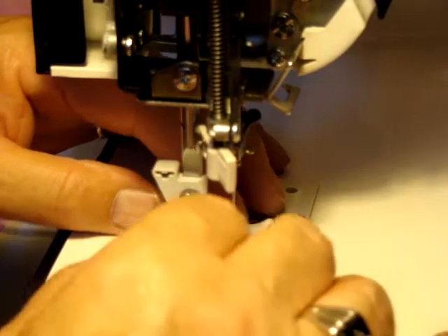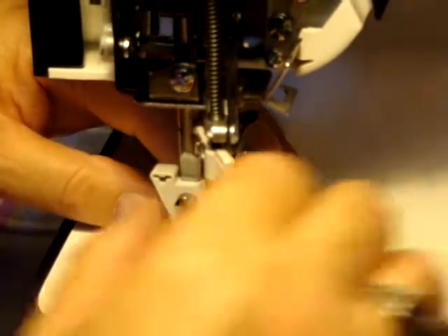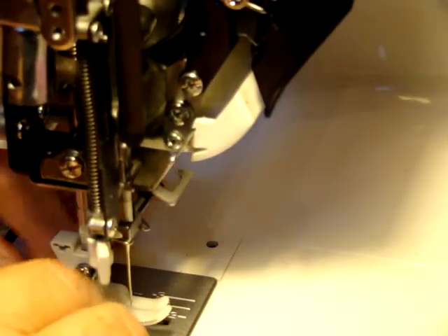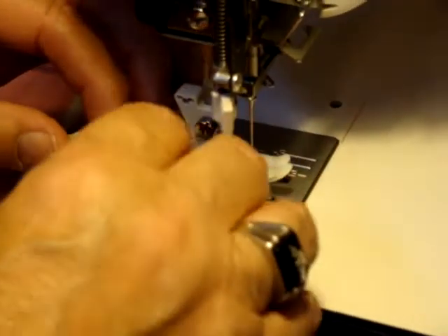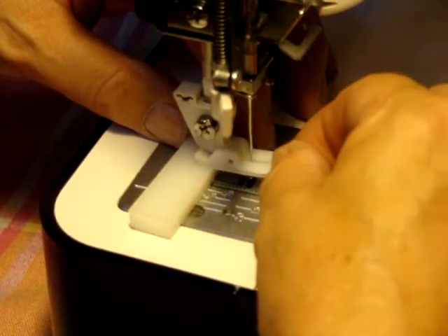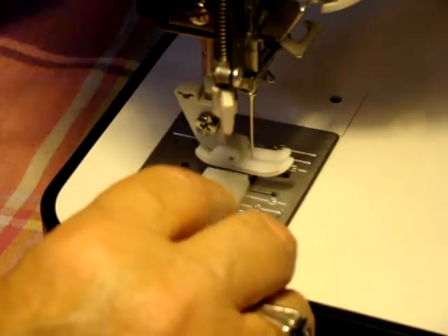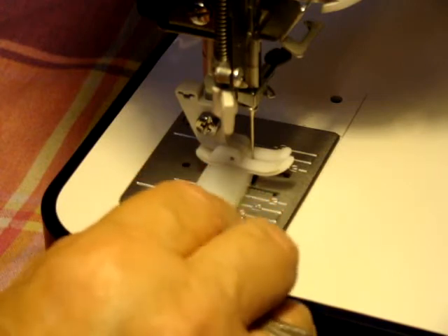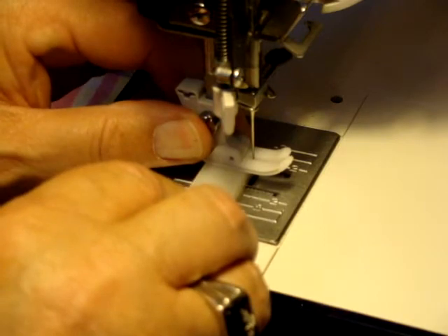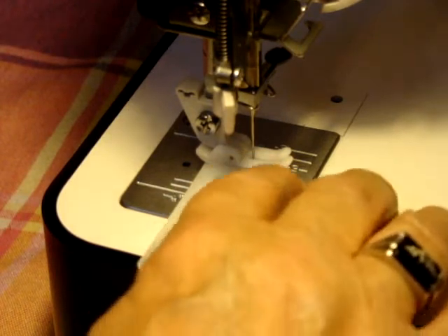So then I want to measure it here. I've got to move it down — just wiggle it down until you get it to that quarter inch. Sometimes you go to the edge, but this here is the narrow foot. Remember, if you've got it hinged here, it's got to go underneath the part that's more unhinged. So I've got this here and I bring it up to that height. You'll probably have to move the balance wheel to get the feed dogs to go below the plate.